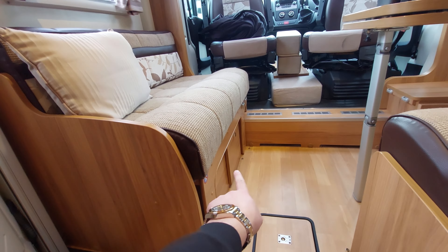Your control panel is just up here. To switch everything on you've got your master switch there, and your water pump — what that does is pump water from your fresh water tank through the system, fill up your boiler, and eventually come out of your tap. When you fill up with fresh water, switch your pump on, come over to your sink, open up the hot water tap by your mixer tap, wait until you get a pure flow of water coming out. You then know you've purged all the air out of the system and filled up your boiler — you can then switch your boiler on. Don't switch your boiler on without doing that first, otherwise you're just heating thin air in the boiler.